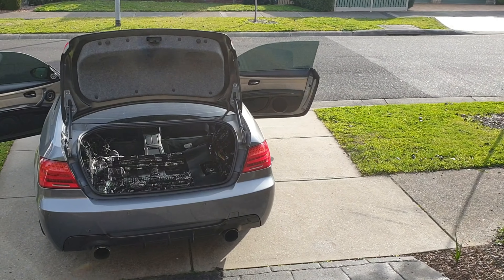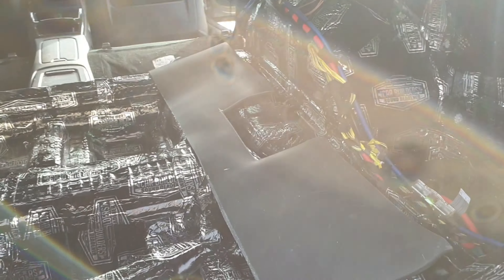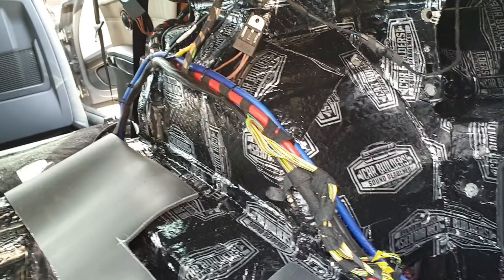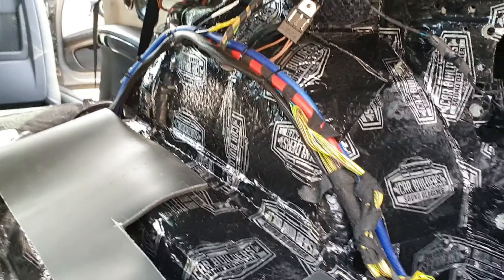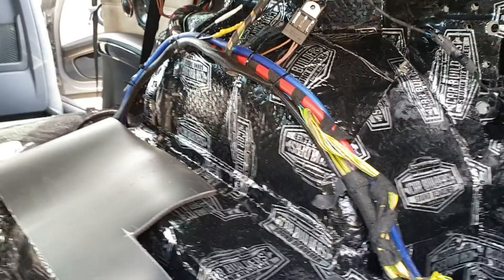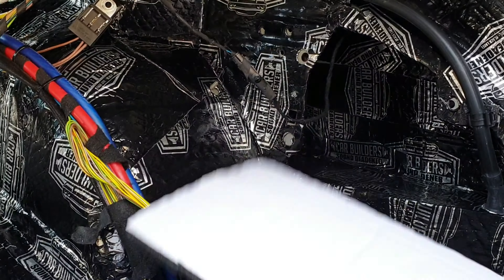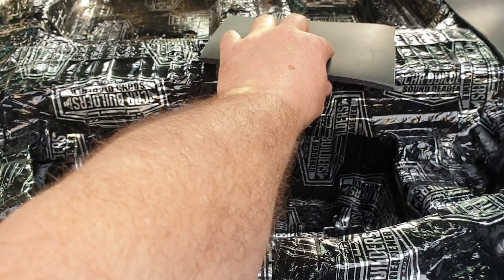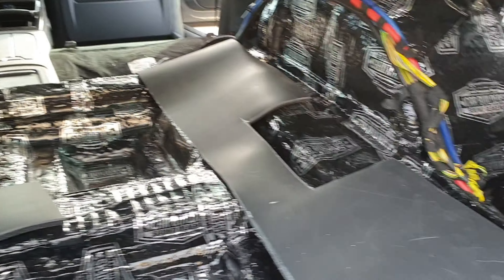Welcome to the next video in the series. We finished the sound dampening in the rear of the boot and now it's time to apply the acoustic layer. I'm going to be using a couple of different products. On the wheel wells I'm going to use mass-loaded vinyl light for the top and sides, 12mm acoustic liner self-adhesive foam inside the body skin, and a heavier mass-loaded vinyl for the floor.